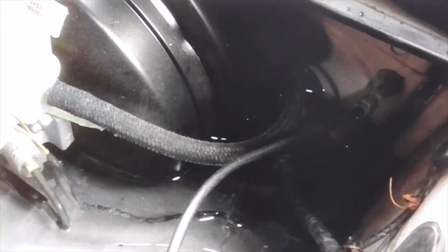You have to remove the hose and the dirt. Clean it from time to time to prevent water from accumulating, puddling and rusting this piece. This piece is made of sheet metal and it would end up rusting. Water would enter and the piece would be useless, with the consequent danger that it would no longer brake.